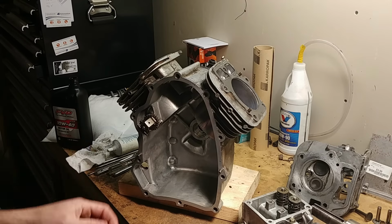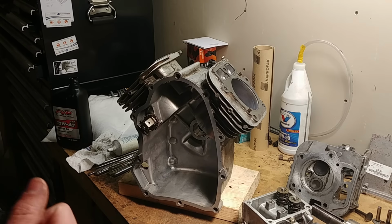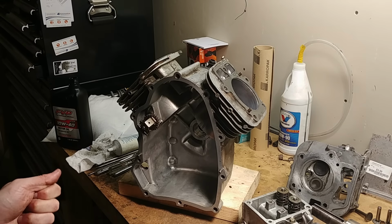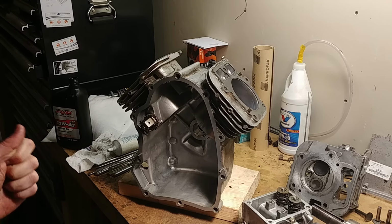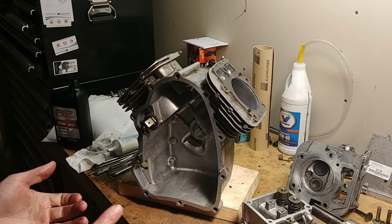The nice thing is it sticks. It doesn't run out. It stays in place, and it's real thick, filmy. So during that initial startup, it keeps things lubricated before your pump can pump some oil up. The worst thing is running metal on metal before the oil gets there. A lot of your wear on your engines happens at first startup or initial rebuild.